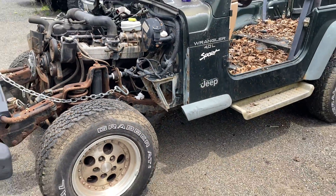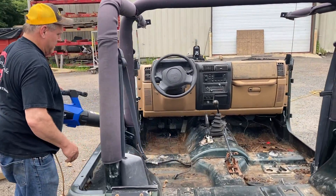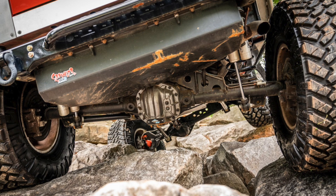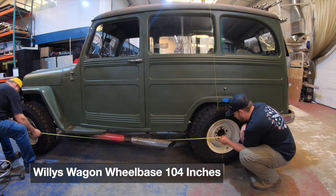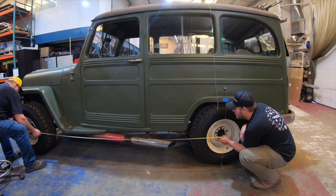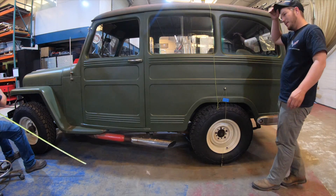In the last episode I talked about why we're going with this particular Jeep. This is a Jeep TJ Wrangler — the first year Jeeps used coil spring suspension — which is going to help us with ride quality and aftermarket support. In the last episode we measured the wheelbase of the Willy's Jeep and it measured 104 inches. The TJ's wheelbase is only 93 inches from center of the front axle to center of the rear axle, so we're going to have to modify the frame and extend it to meet the 104-inch wheelbase we need.